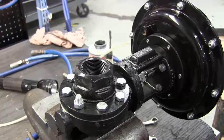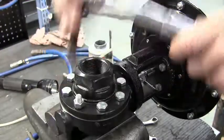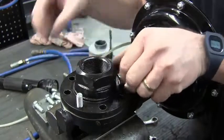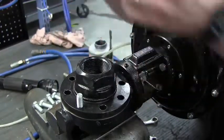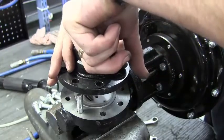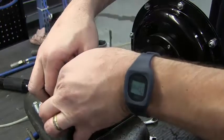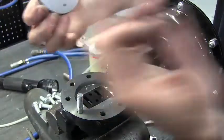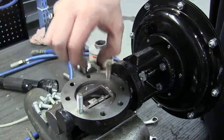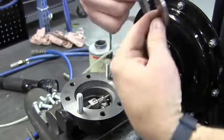This is how to disassemble the valve to change out the seats for a Mark 707. When removing the cap, put your finger inside and hold the plate down to remove your cap so it doesn't stick to it and drop out. Set the cap aside. Remove the plate — be careful the disc doesn't stick to it and fall off — and set that aside onto a clean surface. Remove the disc and set aside. Remove the disc guide.